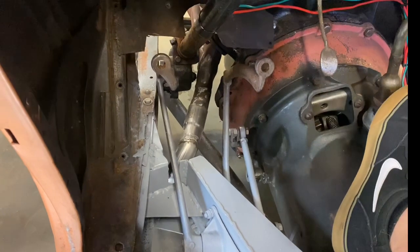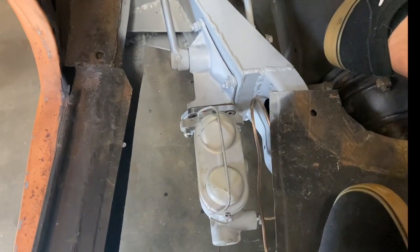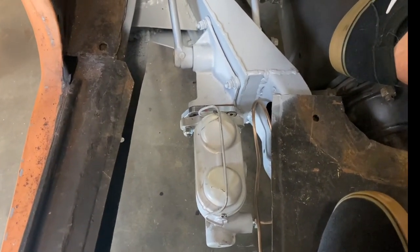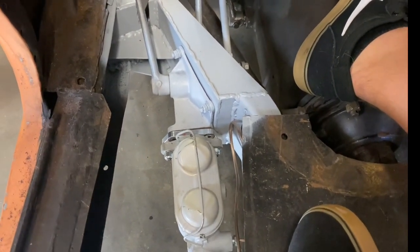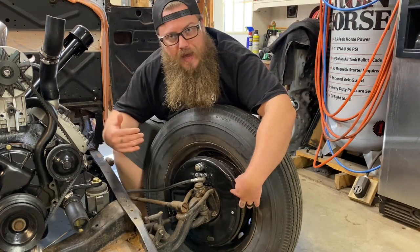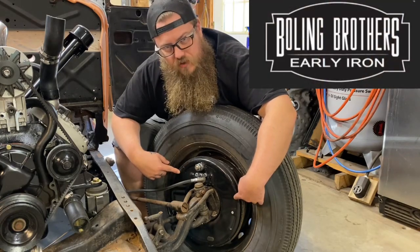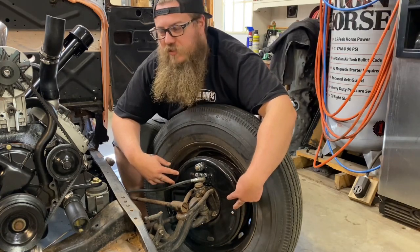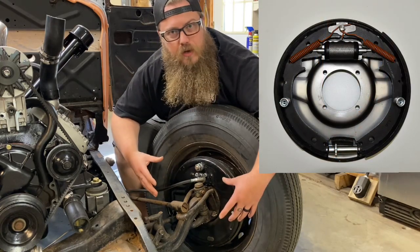It's nice and comfortable, completely adjustable, and it gives us a modern master cylinder because we want the Old Yankee conversion from the 3-bolt to the 2-bolt. So that gives us a pretty nice setup — modern-style hydraulic brakes on a 34 Ford. The backing plates on this 34 Ford, front and back, are from Bowling Brothers Early Iron. These are self-adjusting, self-centering, modern-style drum brakes. They are nothing like the early Ford drum brakes other than looks — they look the part, but they stop and adjust way better than the old-school brakes.